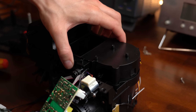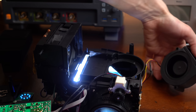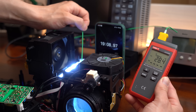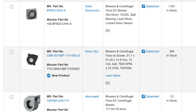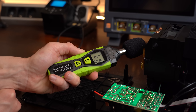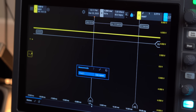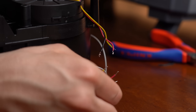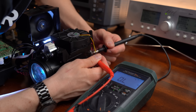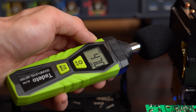After taking even more screws out and removing plastic parts I was greeted by a centrifugal fan that apparently moves air around in the optics chamber where the display sits. This time though it seems like we are not dealing with very high temperatures, meaning we should once again get away with a slower and thus quieter fan. Only problem was that the fan selection was way smaller and I could only get my hands on one which was actually louder than the original. At this point I thought about adjusting the speed of the original fan through its yellow wire, but as it turns out this wire only measures its RPM. So I cut its 3 wires and put a 9V regulator in between both sides, which turns our 12V into 9V. This way the fan spins slightly slower and thus produces a tiny bit less noise, which at this point was good enough for me.